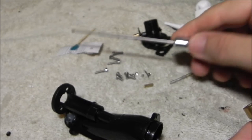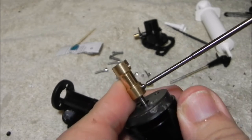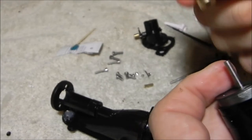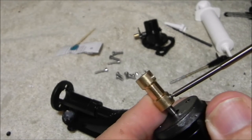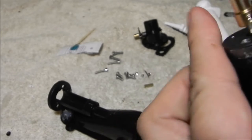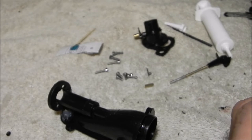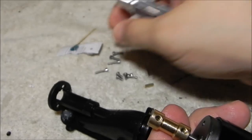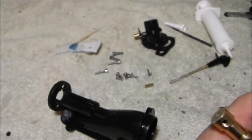There's actually a 1.5 mm Allen key that comes with this kit, and you'll probably also need a 2 and 2.5 millimeter, so getting a set of these is a good thing to have if you're doing RC work. We'll just dip the toothpick in the Loctite and bring the set screw down until it makes contact with the flat spot on your shaft. I usually like to back it out just a hair, then put one on the other side. This helps center your motor shaft and coupler.